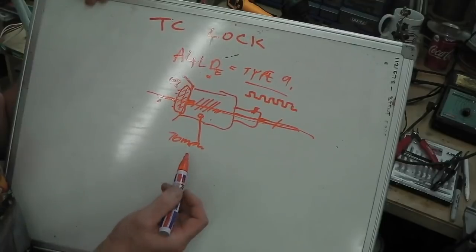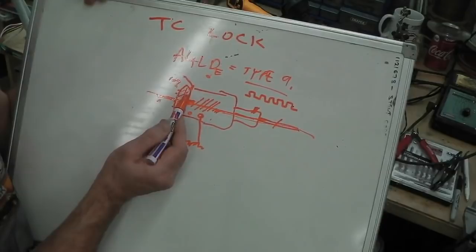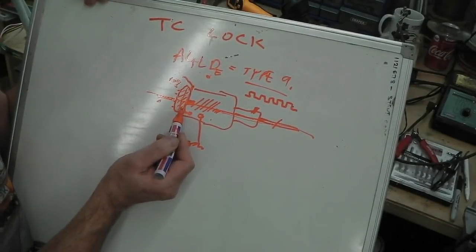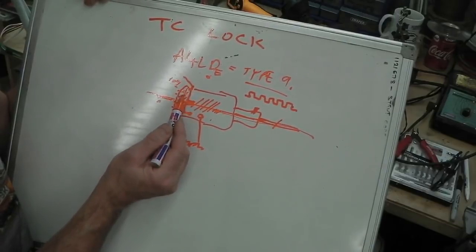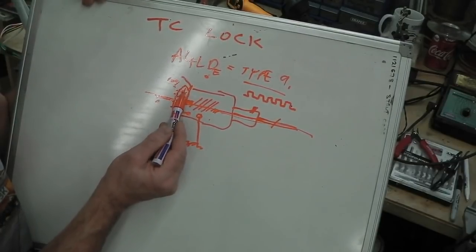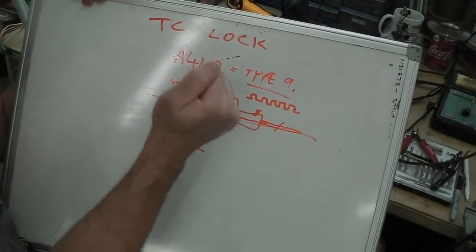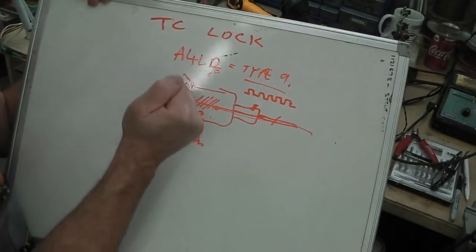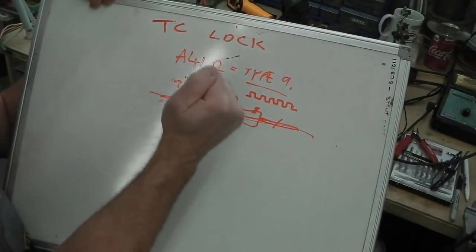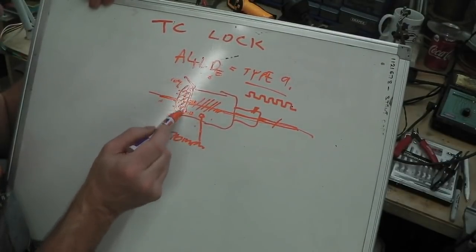So the lockup works by, there's a little solenoid inside here, and then there's some grab plates inside the torque converter. It opens a little channel and fluid can get in and force open these little grab claws, or however they've done it, a pressure plate, but it effectively locks it, so it's no longer spinning in that cup of ice cream we talked about, where you could slush it around. It makes that solid, so I'm now completely turning the whole thing round. No more fluid going on. Switch it off, turn off the 12 volts power, and it becomes back to the torque converter.